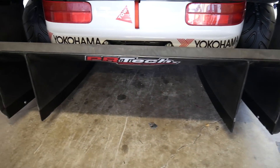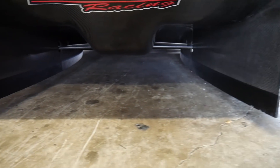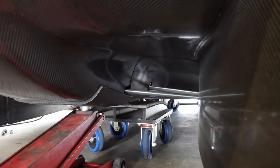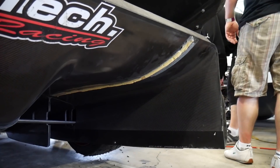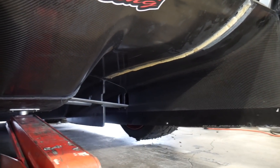Moving back further, there's quite an extensive diffuser system starting from just behind the driver's seat — a convex-concave design. How does that behave in terms of pressure peaks and how air is drawn in from the side of the floor? It's really critical for these cars to start the diffuser as early as possible, as that helps generate the center of pressure closer to the center of gravity. That initial rise creates a suction peak, but the shape must be carefully managed — if overdone, the flow will separate and the rest of the diffuser won't perform as well.